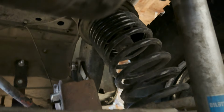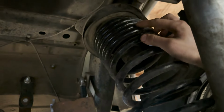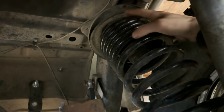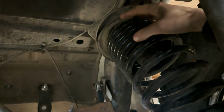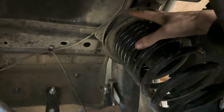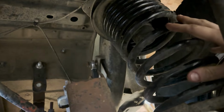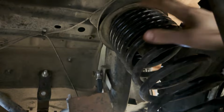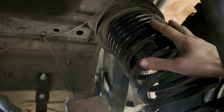And back here, as we were talking about with the springs, these dual rate springs, well, they're great for when this is light and then this is all the way expanded. These springs, this top section, if your suspension is drooped out, this will lift up and expand this whole coil spacing. These will expand and then keep the coil in the bucket. We don't have that much travel. I'm on a short arm lift, and that doesn't matter whatsoever. So what we need is a stronger coil back here at a higher pound per inch that's going to keep this upright.